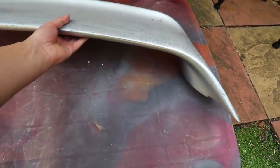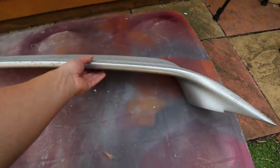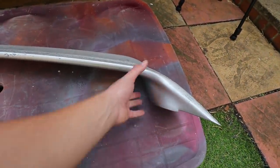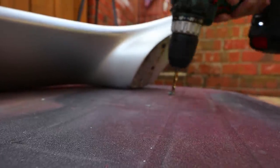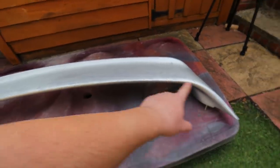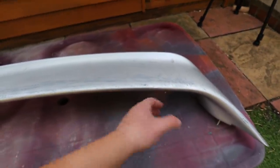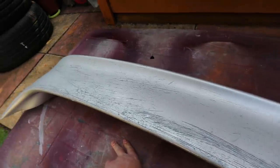I also want to find a way of getting it to sit upright as it would on the car, because naturally it wants to fall back. I might drill a couple of holes in this table and put a couple of bolts through just so it sits upright. I managed to bodge a little hole in the table — I've put a bolt through and threaded it into the spoiler, and it now holds it so it's not touching the table. I'm only really going to be painting the top, and I'll just re-lacquer the bottom — the silver on the bottom is fine. So I'm going to get the sander and sand all this down until it's smooth, and then we'll get painting.